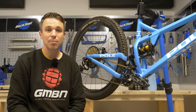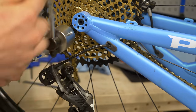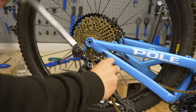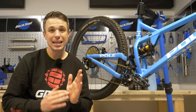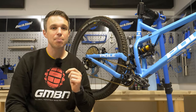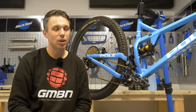After that, look at the mech itself — this is a very effective and cheap way of checking alignment. If the mech is out of alignment, either do the Popeye method and go at it like a man possessed, or just take it to the shop — the latter is better as they have the correct tools. The hanger and derailleur need to be well aligned. Bear in mind that the more times you twist and deform a metal, the more likely it is to break, so if you're bending it between extremes, it's probably a good idea to replace it.